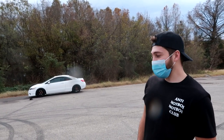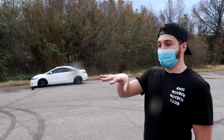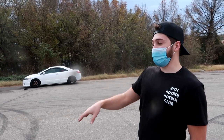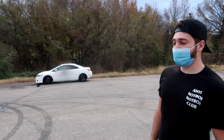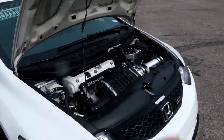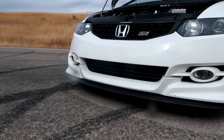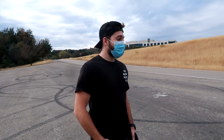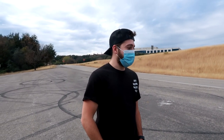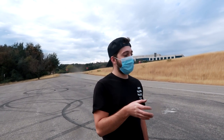I'm also thinking about making a second reservoir for the supercharger intercooler in that battery spot, just to clear out some space. It depends how you look at it — people who do autocross want weight balance in the back, but for drag racing you want more weight in the front. I was really just trying to clear out space. My intake temps are usually pretty good, but I'll probably do a second heat exchanger as well — another one down there.